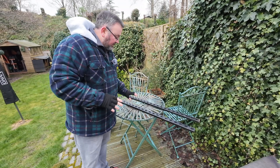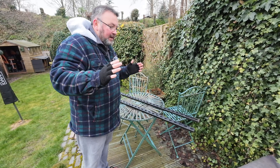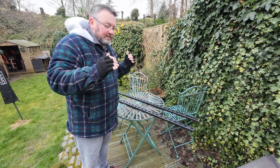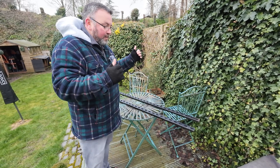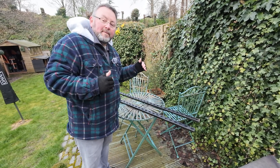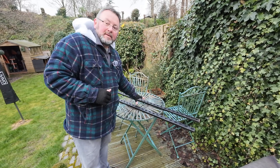I've purchased four three-meter length pieces of Unistrut. Two of those are going to go down either side of the van — I've got a medium wheelbase Transit and those two three-meter lengths fit perfectly. The other two pieces, as luck would have it, I can cut into 1.5-meter lengths, pretty much in half, and they're going to go across, with the solar panel mounting to these.